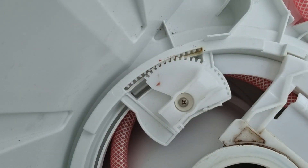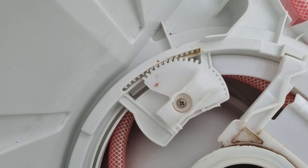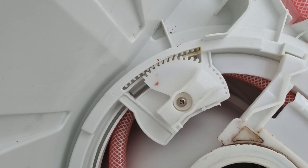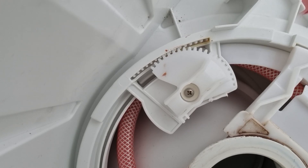Now what we'll do is go around here and I'm going to remove the toilet cassette and you'll actually see what's happened. Now you can see that device here — that's the bit that turns the knob on the top of the toilet cassette. You can see it's facing straight out, meaning it's ready to receive the cassette in a closed position. But as you noticed, the handle inside wasn't in the closed position. So what I'm going to do is go back into the caravan, close it, and you'll see what happens to this device.